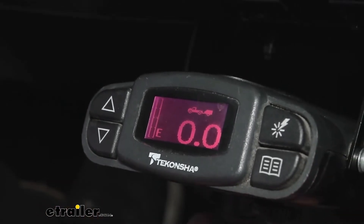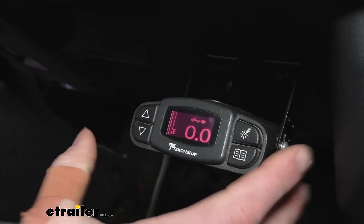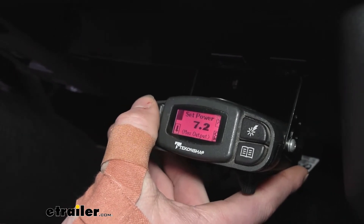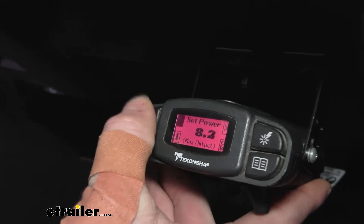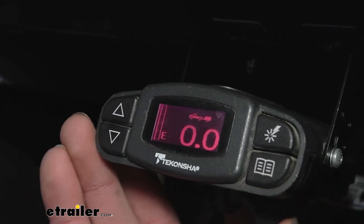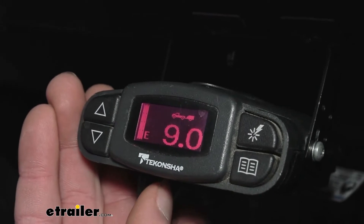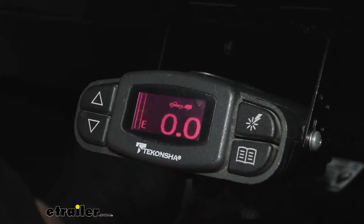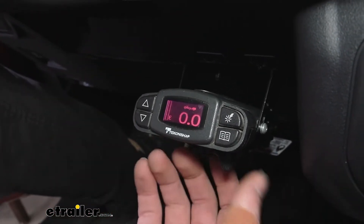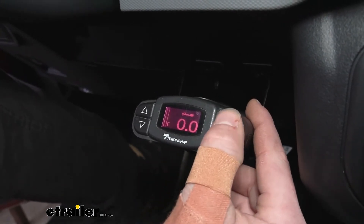This has customizable options, but we still have the standard manual override and adjustments. Once it's installed, take the trailer out and dial in the setting for that specific trailer. If it's kind of in between — not too heavy, not too light — around nine would be good. Click OK and try it out. This is a proportional braking system, so the manual override is really just for emergencies. It applies the same amount of pressure you're applying to your brakes, which is going to save your Bronco's brakes from getting overheated when hauling bigger loads.